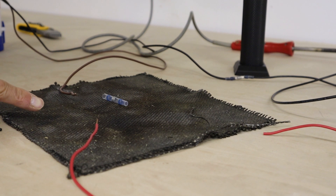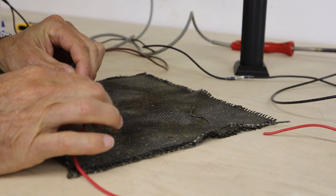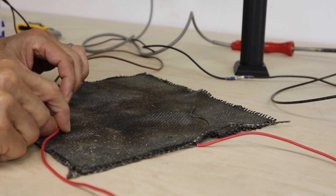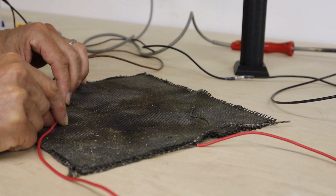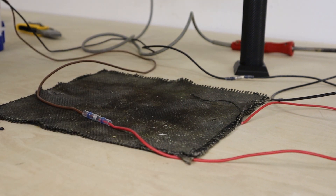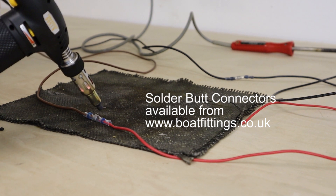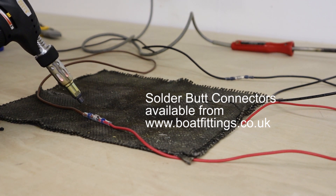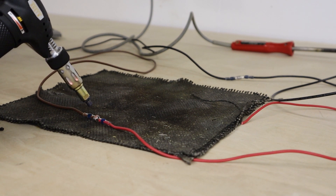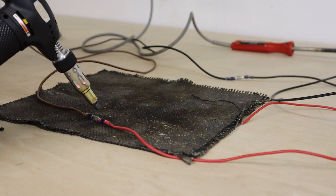With these red wires I'm going to do these the simple way, which is to put the solder butt connector over one of them and interlock the strands of the wire. We're going to bring the butt connector over the top so the solder ring is lined up with where the wires are pushed together. Now we're going to bring on the heat and gradually heat the whole connector up — you can see it's shrinking. The blue sealing bands of adhesive are doing their job, and lastly the solder ring is going to melt, and there we have it.